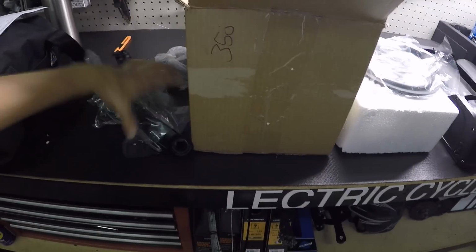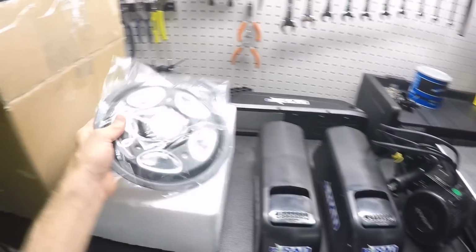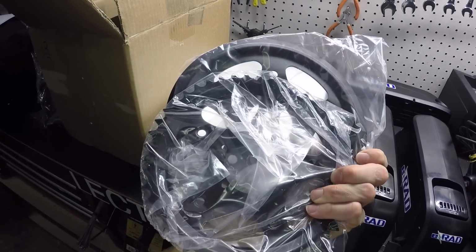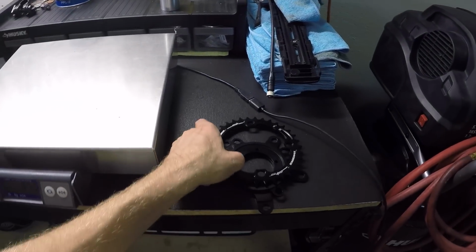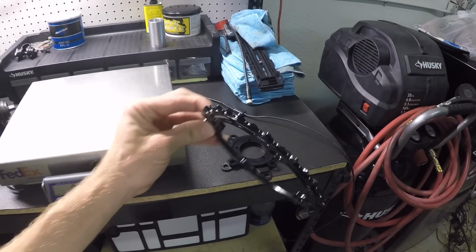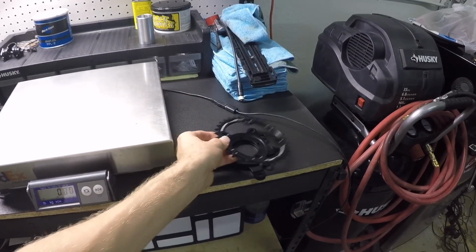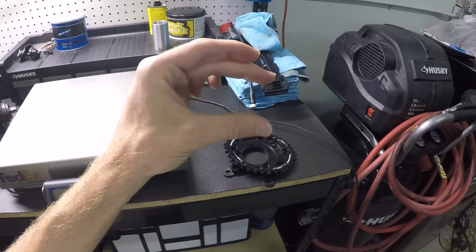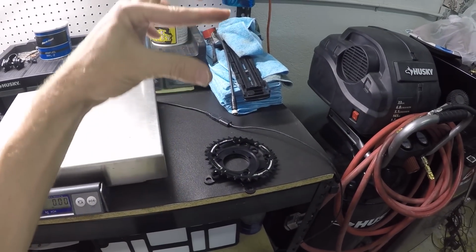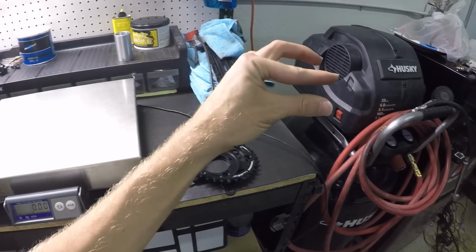One of the other really cool upgrades or customizations they offer is you don't have to stick with the stock steel, really wide chain ring. These guys can work with you, and you can choose from one of 3 Race Face chain rings. So this is a 34 tooth. It goes narrow wide, and that just means that in your chain there's these links and they go together like that. Well, the slot is narrow and the next slot's wide, next slot's narrow.